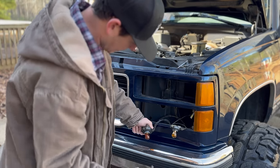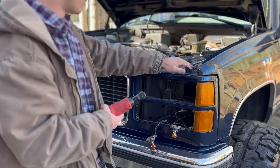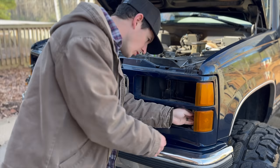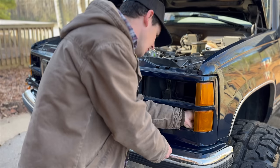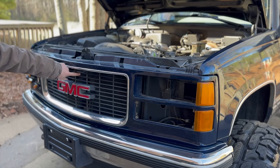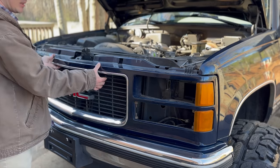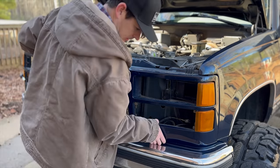Always a good day when those aren't completely flaking around, just absolutely ruined. On my truck we have four 7mm bolts holding the grill on. You do have a bulb in this corner marker right here, so go ahead and unplug that on both sides. Almost forgot the most annoying one right here in the grill - somebody was probably yelling at me through the screen saying don't forget about that one, you're gonna break it. Well, I didn't break it, but I did totally forget about it.